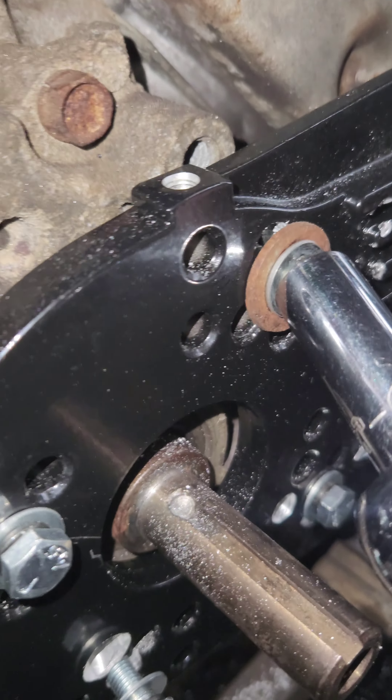There it is guys — it was definitely the custom shop, that's for sure. So, time to install all the parts back on. It's snug back here. I'm going to go with the 40-41 sprocket, and the washer, and the keyway, and slide this guy back on — secondary clutch — make sure it's lined up.